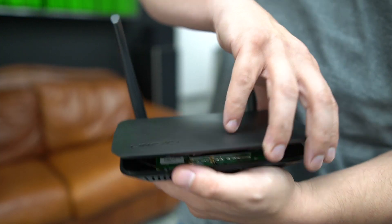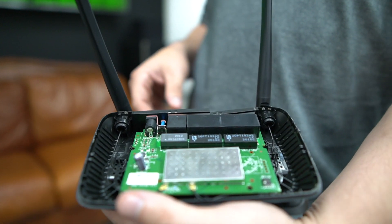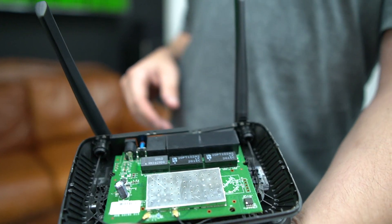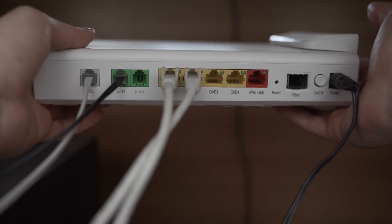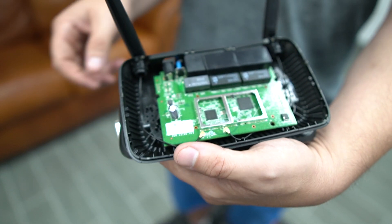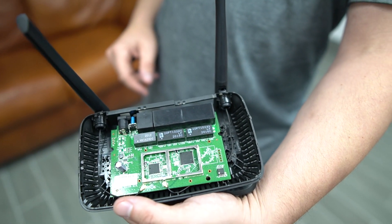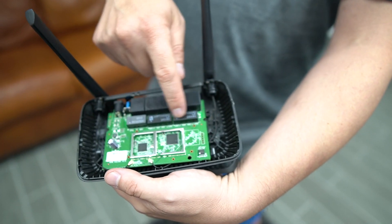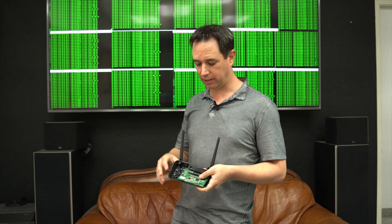When you look at all these things and combine them into one cheap device, it's going to suck compared to the stuff the internet uses, and I'm going to tell you why. So here you have your home router. When you open it up, you have your little components in here. It doesn't matter which ones you get — if you get them between $500 or even higher, they are all pretty much the same. They just look a lot different on the outside. You have your heat sink that makes sure your Wi-Fi chipsets don't get too hot, and then you have your Wi-Fi chips. This one is 5 gigahertz, this is your 2.4 gigahertz — it's about double the size because it's about double the wavelength. Over here is your flash memory. These are your LAN controllers. Over here is your actual processor that's controlling everything.